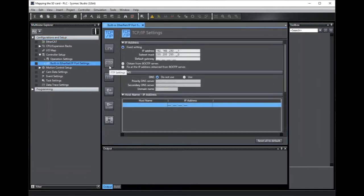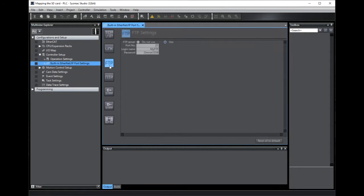You'll find a button marked FTP on the left-hand side. In here I've prepared the controller — I've clicked on the Use radio button on the top right. I'm using port 21, which is the standard port used by FTP services. I've added a username and password for authentication so that only I can access this folder if I know the login name and password.